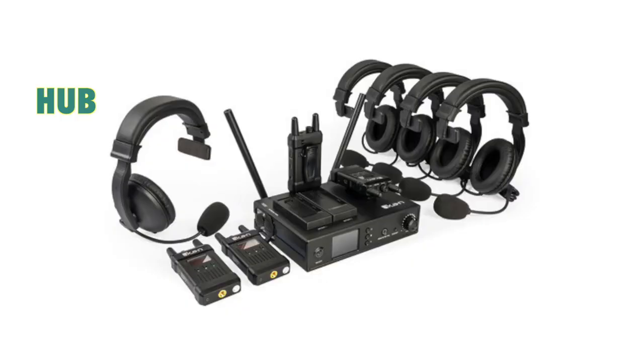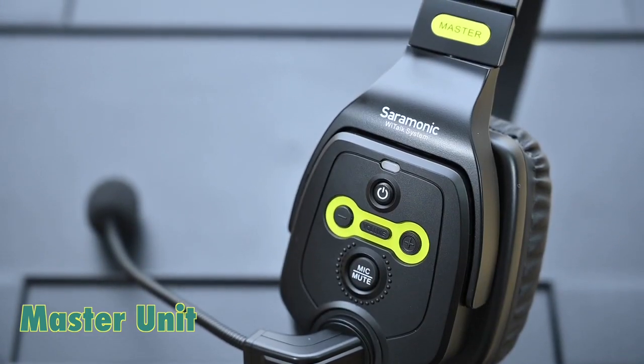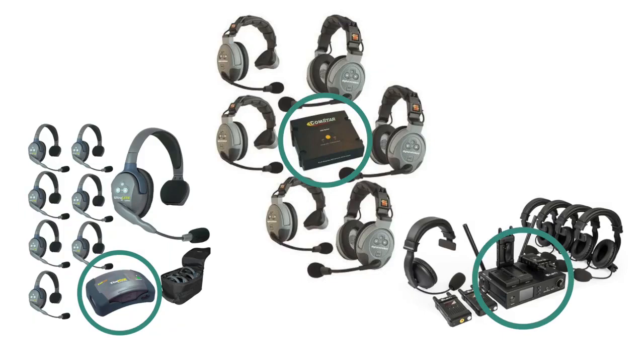By using this lower frequency, it's in a less crowded range, and the lower frequency gives it more range. Here's the smart part of how Ceremonic made this unique. A lot of communication systems have a hub — a box you have to carry, which is not fun. But Ceremonic made it so you don't need that box. One of the head units is actually a master, so everybody communicates through it like a middle man. From the master to the nearest remote is 400 meters, then another on the other end — so the effective distance is 800 meters, almost a kilometer. That's how Ceremonic extends the distance without carrying a box.